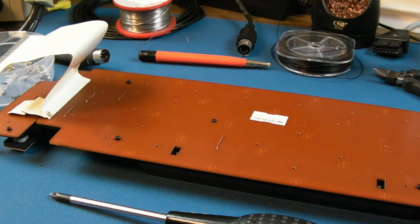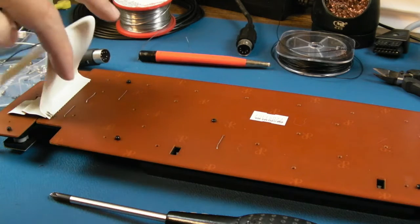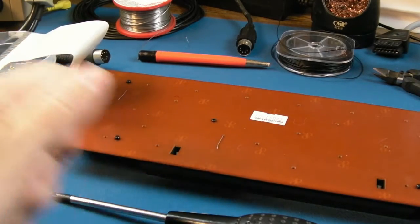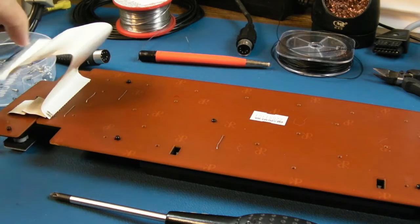Right, so taking the keyboard back to pieces again, because I worked out the issue. The motherboard is handling the reset correctly. It's these two pins here. Can you see they look a bit shiny? I scratched them back there, and this is what's happened here. Just by virtue of someone going into this machine, bending this cable around left, right like that, it snapped it off. And it's these end ones here.